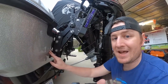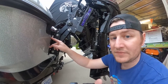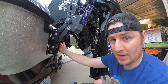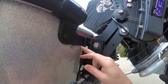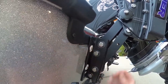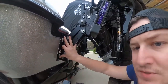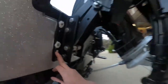If you open it up and feel in there, you'll feel a square plate — it's aluminum. My first caution is that plate is not very big, so when you go to lay out your bolt hole pattern, make sure you're hitting that backer plate. It's about six inches tall and probably ten inches wide. I drilled my first couple of holes — there's a little ledge right here so I had to drill below that ledge to avoid a gap. Drilled that first hole, went down, drilled the next hole.